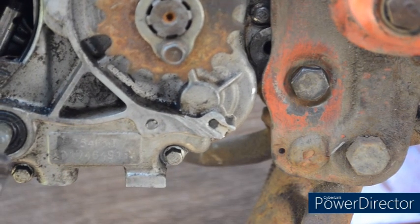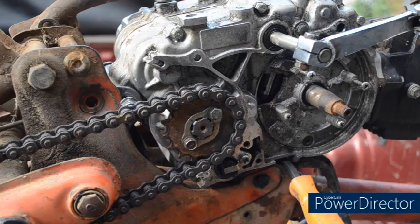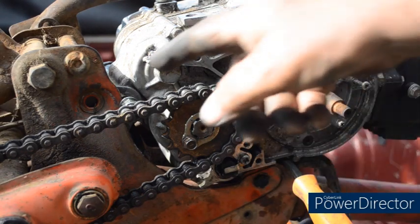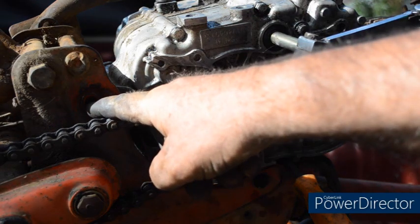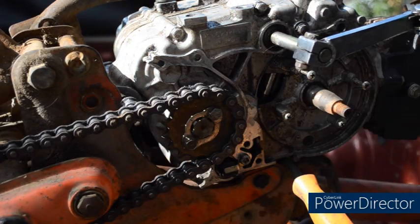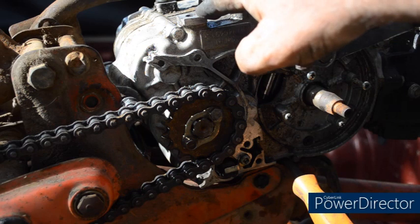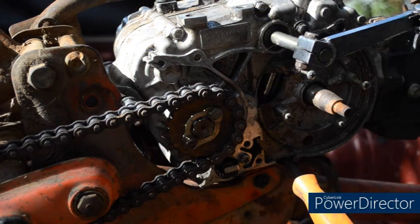The whole plan is to do it without modifying the Honda frame in any way. I fitted a chain to check the alignment — the chain is running right at the edge of the sprocket. My plan is to use two plates, using the original mounting there and the Honda frame mounting there. I don't know if it will work, but I'm going to give it a try. I'm hoping it will be a much stronger, better mount than using a flimsy strap across. A solid mount there will damp down the vibration and make the bike much better.